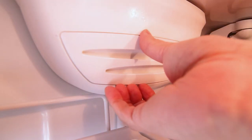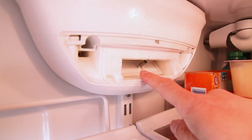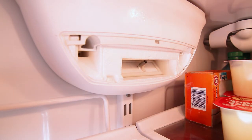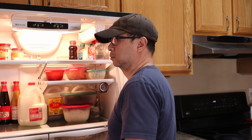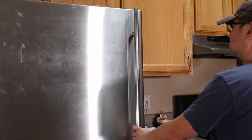In the back of the fresh food section, the damper will close and the compressor will immediately shut off. I'm just doing this to show you the closed damper, but you don't have to take this cover off. At this point, just close the door, let the force defrost cycle finish, and repeat as necessary later in the day.